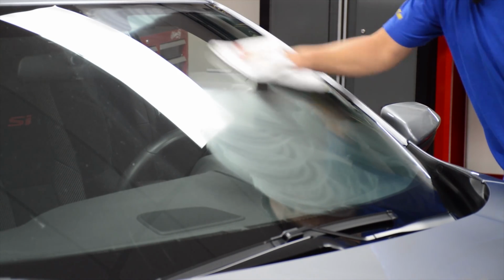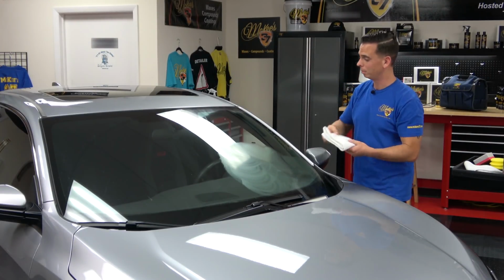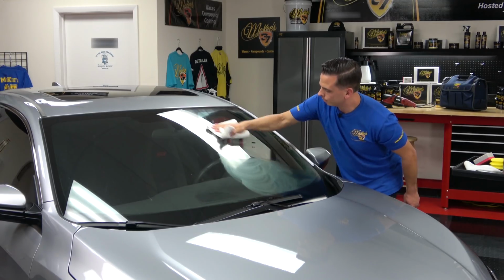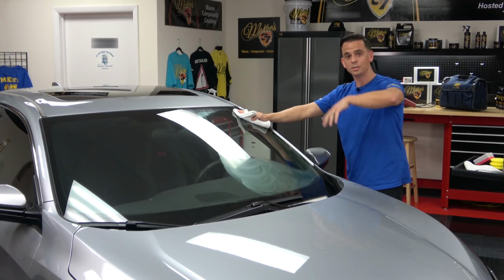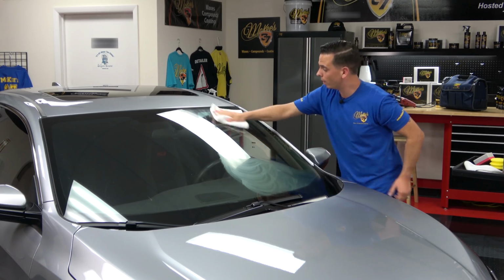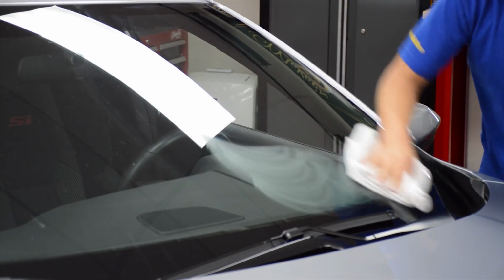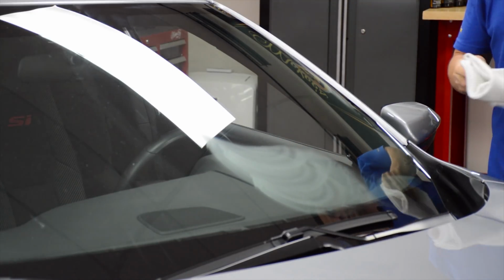Whenever you're wiping off a polish or a wax, you get much better results if you do it slow and firm. Well, not necessarily firm for paint, but for glass, the polish comes off much easier. Now, High Performance Glass Restore, you'll find 1,000,001 uses for this product. If you have glass shower doors, you get the calcium and the lime buildup, this will take care of that. If you have a glass stovetop that you've been neglecting for a while, it'll clean that as well. And as the residue gets built up on the towel, flip the towel to a second clean, dry side. Again, plenty of towels.